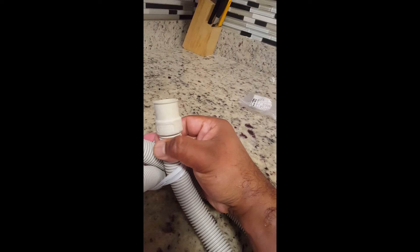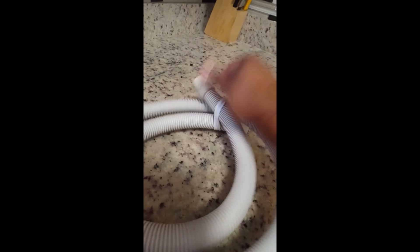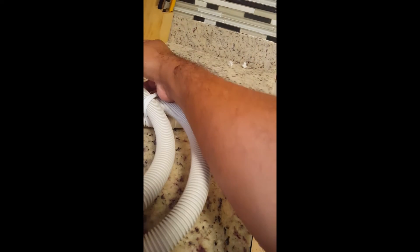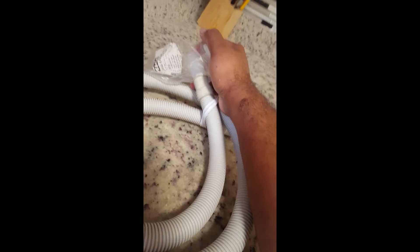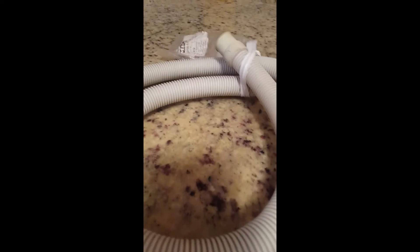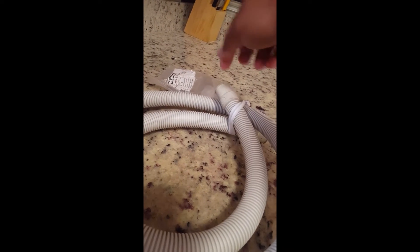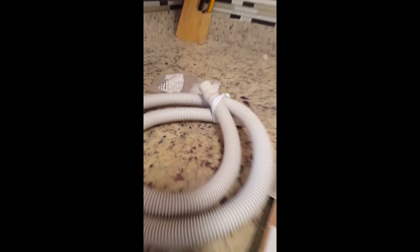The recommended part is an additional drain hose — the part number is 06401480. You'll also need an adapter; that part number is 164212. This connects to the other drain hose and avoids having a drainage problem at the joint.